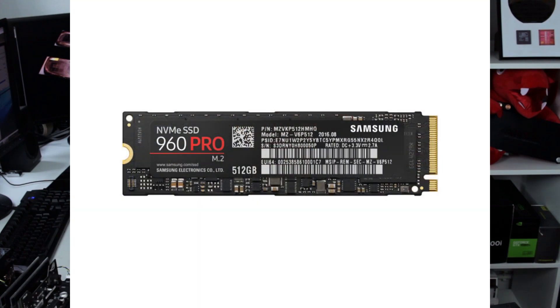So we only have about 3.9 GB per second available. If you use a Samsung 960 Pro, read is about 3,500 MB per second and write is about 2,100 MB per second max — so with one drive we are almost at the limit. If we run two drives in RAID 0 over the PCH, we very quickly hit the limit of DMI 3.0.